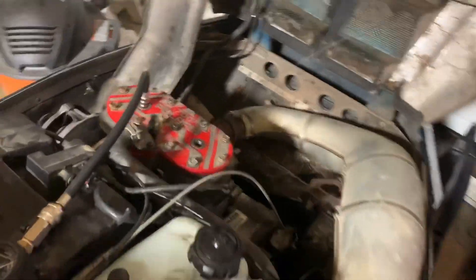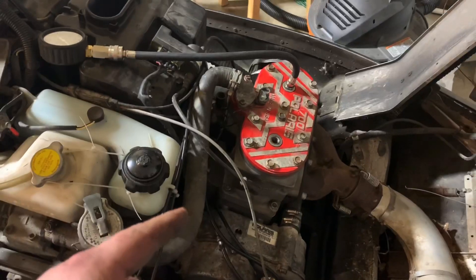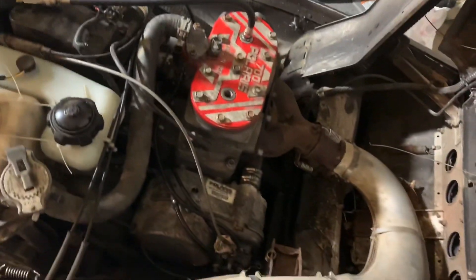I'm a little nervous about starting this thing. I just finished a compression test — it's a little bit under 150 psi in each cylinder. The gauge bleeds off so my picture only shows about 145 by the time I got to taking it. This thing is way harder to pull over than a stock 700. The exhaust is in, I primed all the oil system, carbs are in, electronics are all plugged in, coolant is set up. I didn't put coolant in it because I want to do a test fire just to make sure it's not going to scatter itself everywhere. I went to the store and got some fresh premium fuel and pre-mixed it.